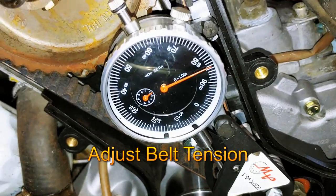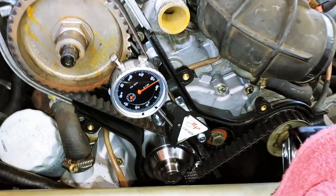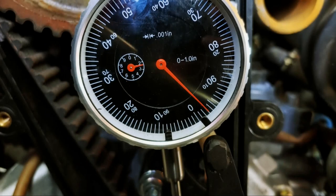As I suspected, the camshaft is a little tight, but I need to take the tension off that side of the belt — that's the next step. Using the instructional videos from Arnworx, I set up the tool on the timing belt and adjusted the tensioner to the specs as instructed. Then I moved on to the balance shaft belt.